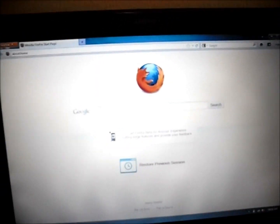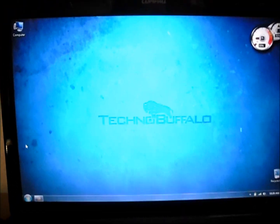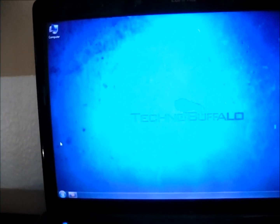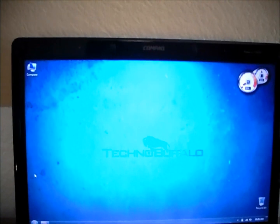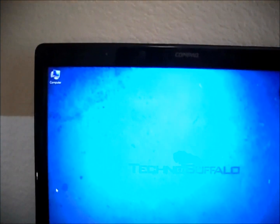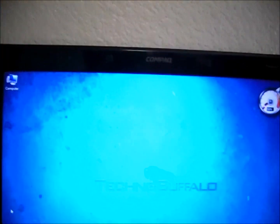Okay. The only 2 problems that I have with this computer: whenever I turn it on without the AC power cord, it won't turn on properly. It would turn on, but you wouldn't get any response from the computer, like loading the operating system; the BIOS would go on. If you turn it on 3 or 4 times without the power plug, it would eventually start. But if you have the power cord in, it would always turn on.